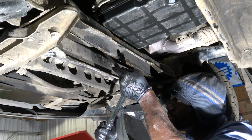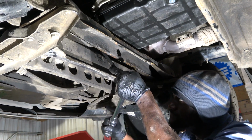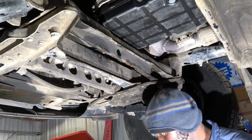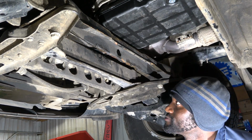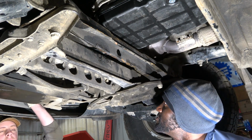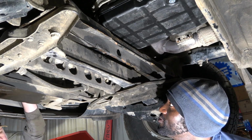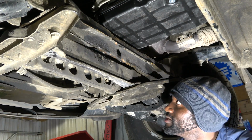So now I'm going to torque the second bolt. All right, so that's torqued to 37. So now you're going to spin the engine, Kyle. So the first 2 bolts are torqued. So now let's torque the next 2. Okay, right there. Stay there.